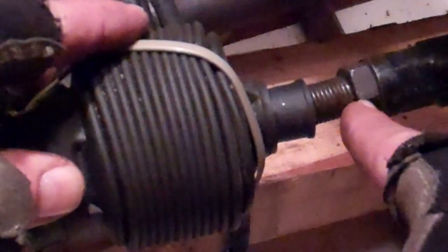Earlier in the procedure, we had loosened off the locking nut for the outer tie rod by about an eighth of a turn. This may not be a bad time — if you've got some nail polish — to match mark that. Clean this off a little bit and put a little dab of something to match mark it. Nail polish is good — just paint it on, let that dry so that you'll know where that nut was.